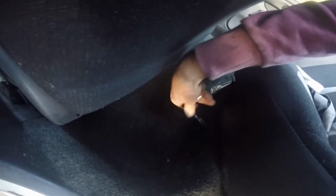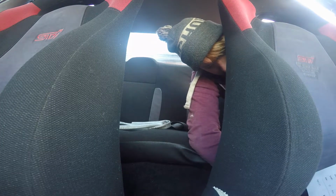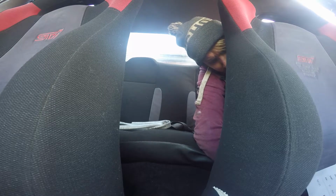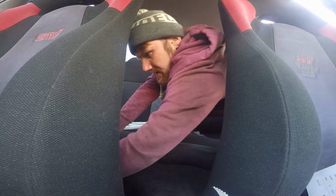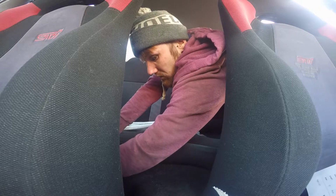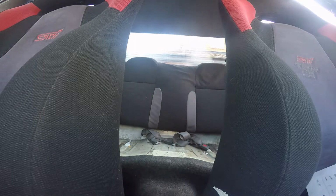As I mentioned, there are some bolts you need to take out. First one being, 12 on. So this one, it's exactly the same place on the other side. So I'll just put this. I usually put a bit weight on the seat, just because there's a, how to put it, like a sliding tang on, and it'll help. Putting the weight on it slides the tang down, just in case you're all the way out the bottom. Right, those 2 bolts out. So now it's just a case of pull it up, pull it out.